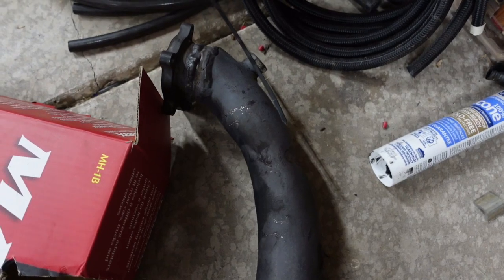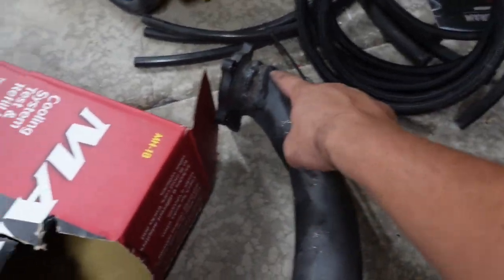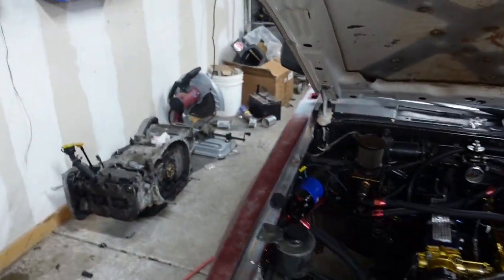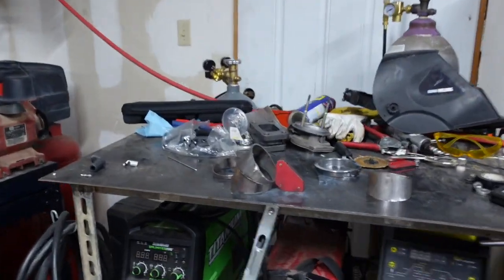Alright guys, so we didn't have any elbows or 90s. Here's my downpipe — it's kind of janky, it's real weird up here. What I did is I'm basically going to cut it here, doing pie cuts here. I'm going to cut this down here and we'll just have to figure out how to get the pie cut to match up to this. Not that hard, we'll just have to do some measuring. There's a little bit of straight left there — not much, like six inches — and then there's this piece and that, so I'll be able to make it work.